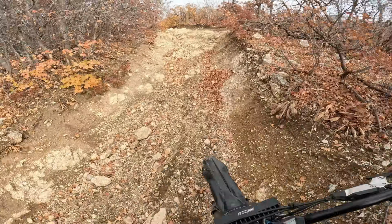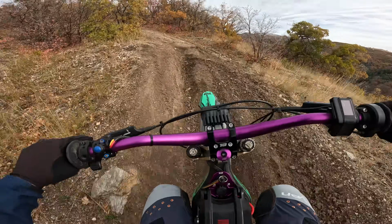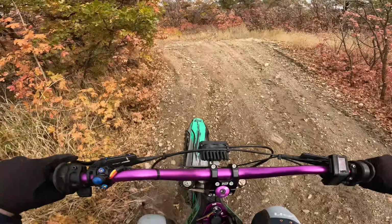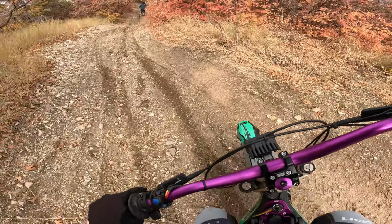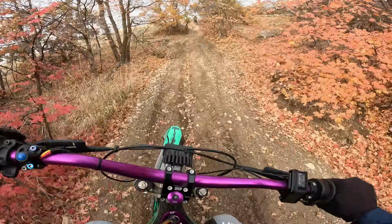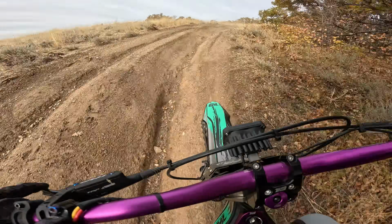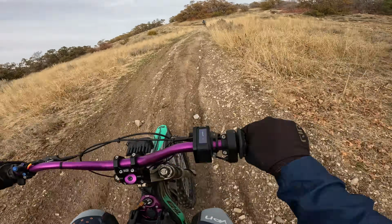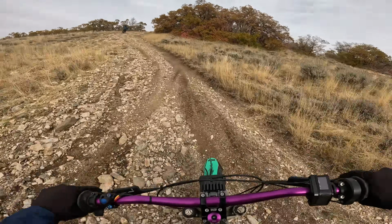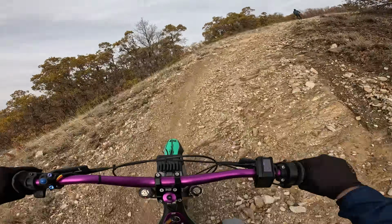Man, this trail is rough. It really is crazy how different the setups feel from bike to bike. Like, even, to be honest, that fork felt a lot stiffer on this bike than it did on that bike, and I think it just also has to do with how the bikes are balanced front to rear. Reed has a riser linkage on that bike, and so it almost raises the back end up a little bit and allows you to have a little bit more weight on the front, so it makes the fork feel softer than it did on this bike.